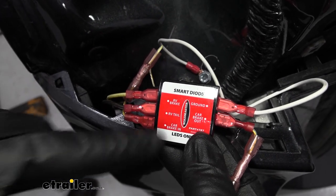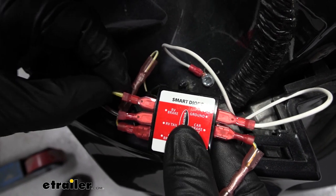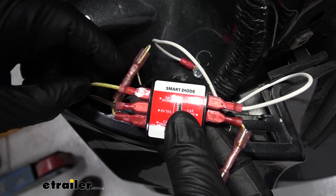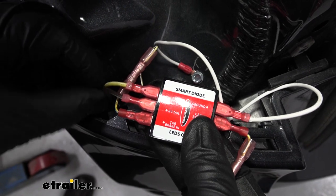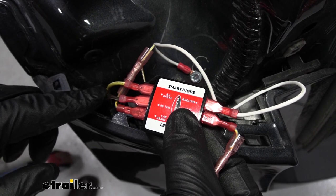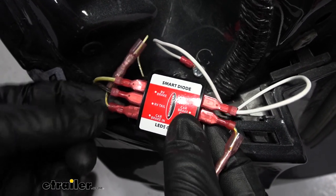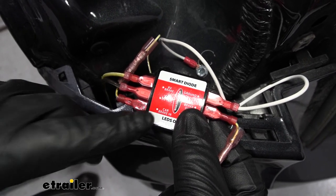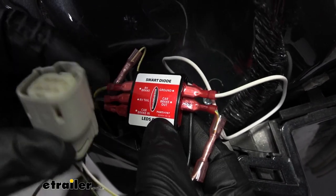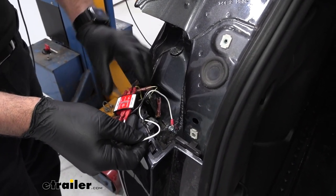Here's the final product — this is what it should look like. We're going to have our yellow wire coming in from our RV — that's from the four-way flat we installed up in the front, and this will be the RV brake. The brown will be the RV tail light, and this also goes to the other side of the vehicle. The car brake in is now the tail light circuit that we've used on this, and then the car brake out just goes to the clip. Then of course we have the ground that we installed right here on the driver's side.